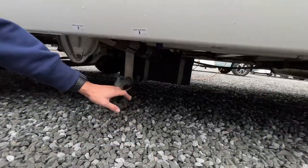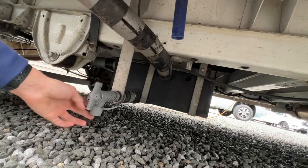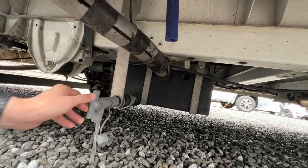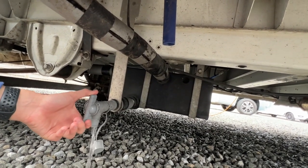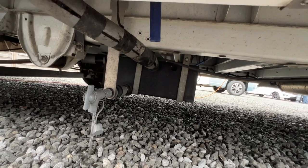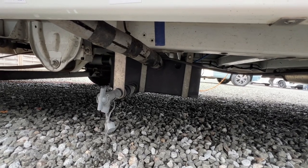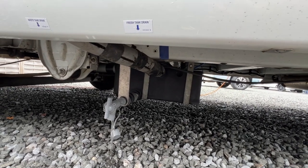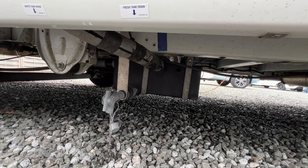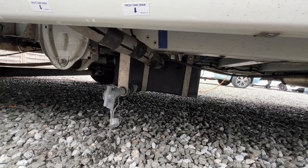Just down here you've got your water drains — one fresh water drain and one waste water drain. For the waste, you just open the tap and drain off the waste water. You don't want to be driving around with the added weight of waste water because it's dirty and will impact payload and vehicle weight. On the way out of your site, drive over the grid and allow the water out. When driving home, leave the tap open and it will rock any loose water out. In winter, make sure both taps are left open and drained so no water sits in either tank and causes damage.